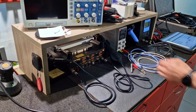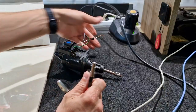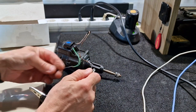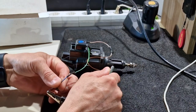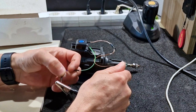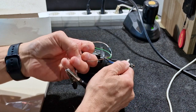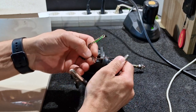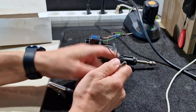I connect to pin 1 and pin 5 and power up my power supply to 12.6 volts. It's working and it sounds good. I don't see any problem - it's working well every time. Maybe the problem is with the position sensors inside, and not the electric motor.